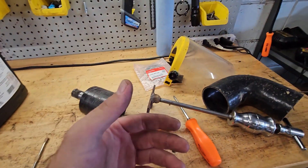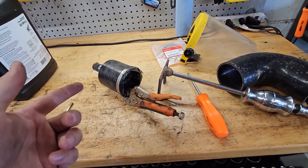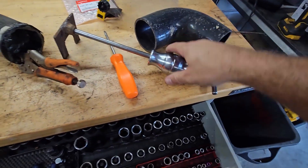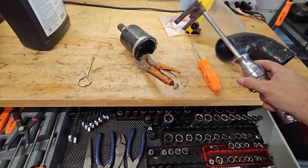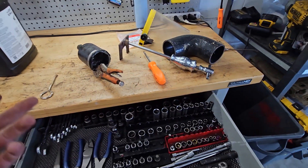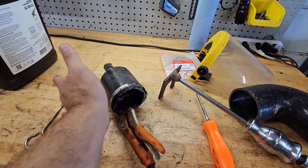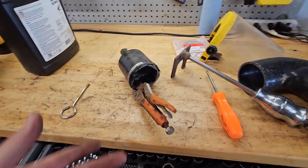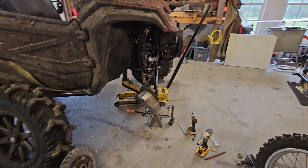Usually on these Hondas when the outer joint breaks, you just grab the shaft and snatch it out of the front diff. Because I had already deleted the shaft and threw it away, I couldn't do that. So I put a pair of vice grips on the side of the cup, used a slide hammer right there, and just let that sit on the lip and it came right out — pretty easy. You could also get a pry bar back here: put a pry bar on one side and smack the other side with a hammer. When you pry here it rocks the joint, you smack it back, it comes right out. So that's out and I'm ready to throw in the new axle as soon as it comes in.